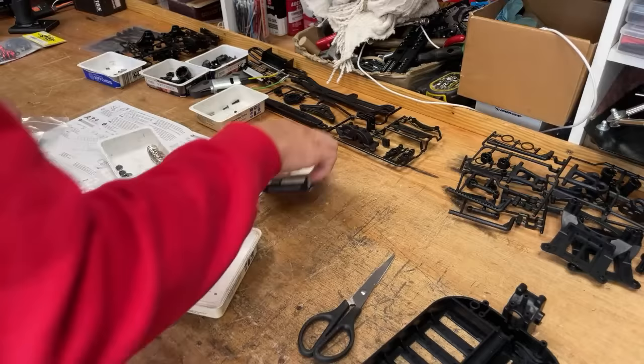I like the buggy racing, really. No, don't ugga-dugga these. These wheel hexes are plastic. They're not strong. I used to do that with a Manta Ray. I used to over-tighten the wheels. You split the hex, and then the wheels keep falling off. Well, no, they don't fall off. The hex splits, and then it goes on further, rubs on the bearing, and it goes tight, then you can never get it tight.